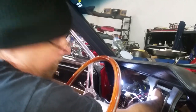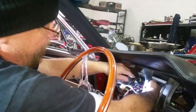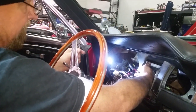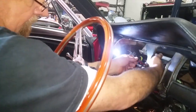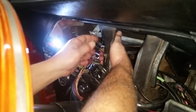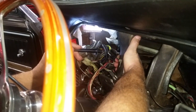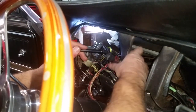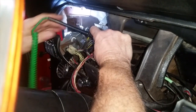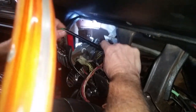Guys, Bill — I've been tearing my hair out trying to figure out why I can't get this thing to crank or get any electricity to the coil out there. There's a red wire with a blue tracer that actually hits the crank. I turned the key and couldn't get anything. I hooked my power probe up and put 12 volts to it and you can hear it cranking.